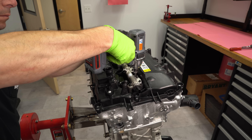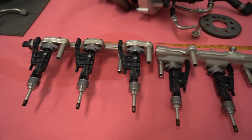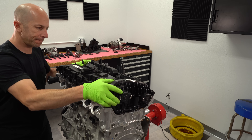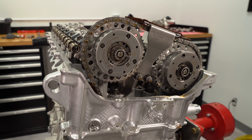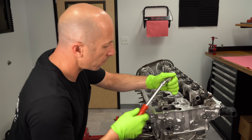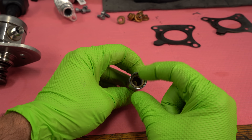This is the fuel rail and these injectors — there's a hole for the spark plug on the bottom and the hole for the injector on the top, and both go directly into the cylinder. Once we get the valve cover off, you can see the adjustable cam gears. The chain goes up to those gears, and the computer can control the camshaft timing relative to the crankshaft to maximize fuel mileage, torque, and power. We actually keep this variable cam timing setup when we build the race engines.